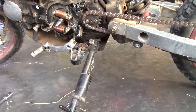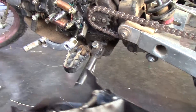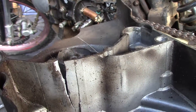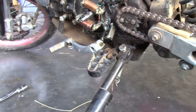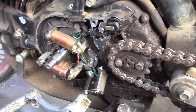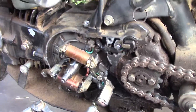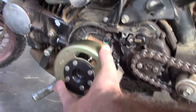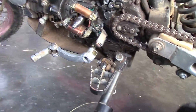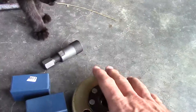Right now I'm working on it. I was riding it about a week ago and the chain popped off, and it ended up breaking through the guard that goes over your stator — it broke that piece. That little magnet got damaged too, so I had to get a flywheel remover tool for that, which I just bought. Let me show you that.